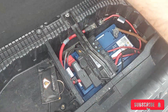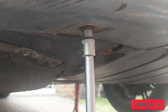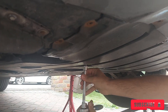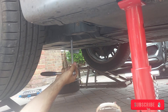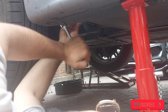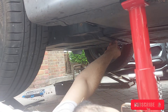First step is to remove the battery. I always remove the battery when working on the car — you never know what you can trigger. Disconnect the negative terminal and put it aside. Next, unscrew all the ten-millimeter screws under the car to remove the plastic cover. There are quite a lot — just make sure you don't lose any. A lot of mine are rusty so I'm putting them in vinegar to deal with that.